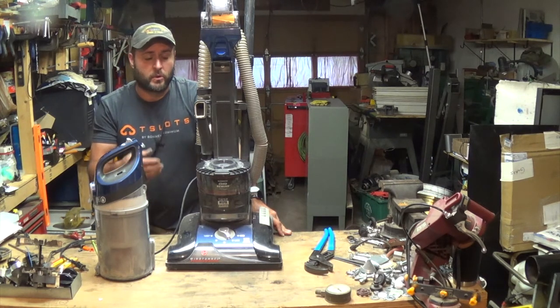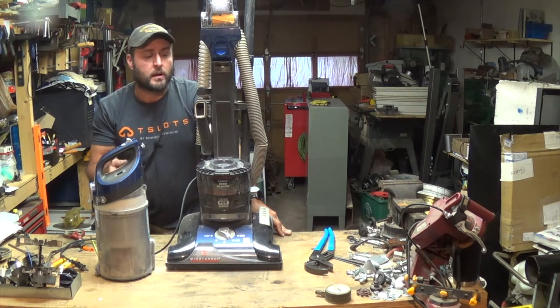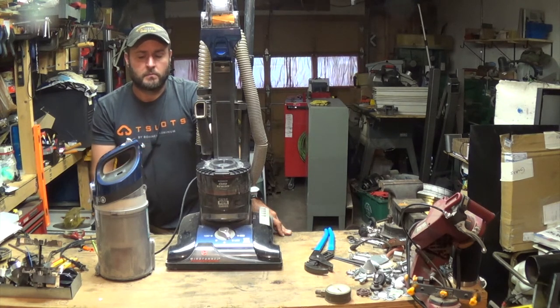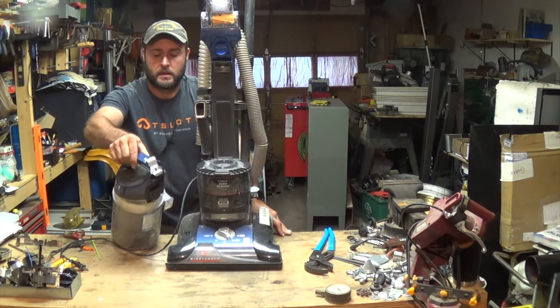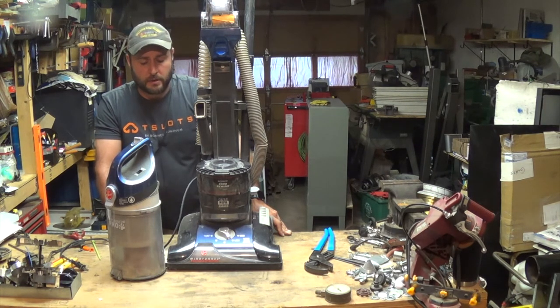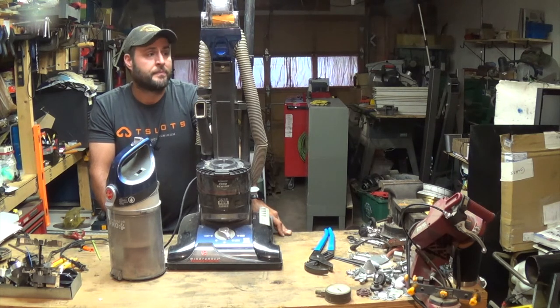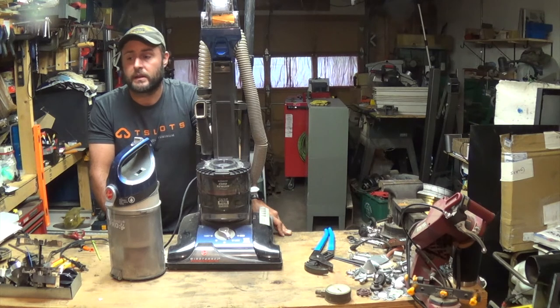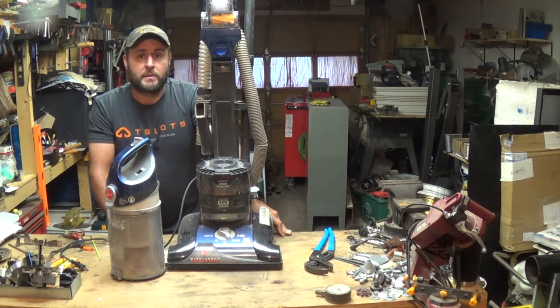I just want to share this — if you run into the problem where your vacuum cleaner shuts off, or is making a really high pitch and then shuts off, turn it off, let it cool down for an hour or so, plug it back in. If it turns right back on, that's probably your problem. Make sure to go through and clean it out so it's not clogged. If it has an indicator like this one does on the top, watch for it turning red — that means there's an obstruction and you need to clear it out. If you have any questions or comments, send them my way. Like and subscribe, come back for more, and until next time, take care.